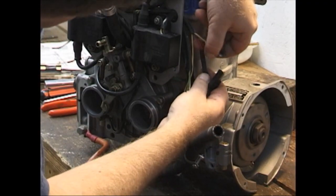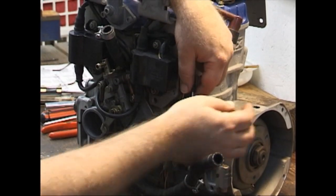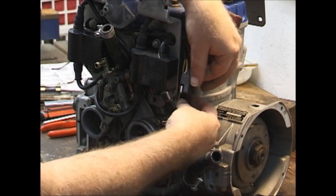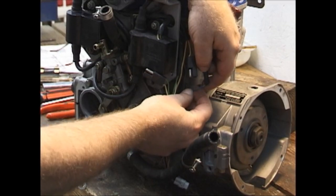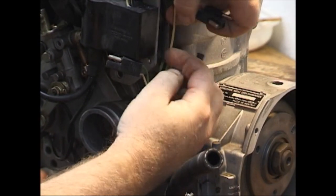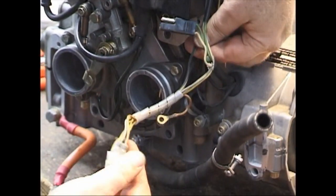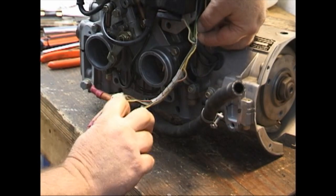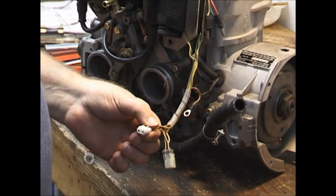This is the power sending coil to the four main ignition generators — to the black boxes — these plugs here. This blue and yellow wire is going to the trigger coil; that tells it when to fire. And this one line returning, which we're going to have to disconnect from the plug, is a kill wire. There are a couple of yellow wires here — they come out of here; they're your auxiliary power, or your AC lighting coils. We need to take this little spiral wrap off.